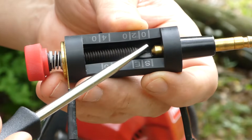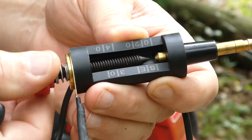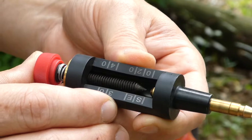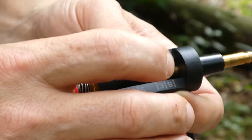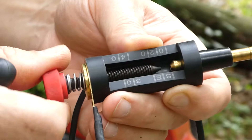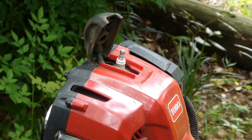So as you can see there, you can see a spark in the gap here. Now the reason that this is like this is because you can adjust the gap in and out. Generally you'd want to set this gap the same as your spark plug, but you can also adjust it out. The reason you would do that is to test how powerful your coil is. If your coil spark is strong enough to easily bridge this gap, which is much larger than a spark plug gap, then you know that there's nothing wrong with your coil.